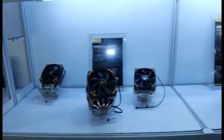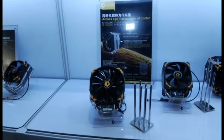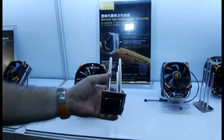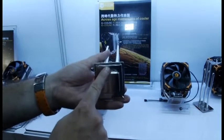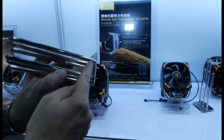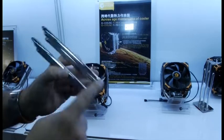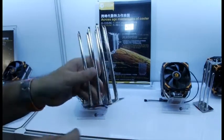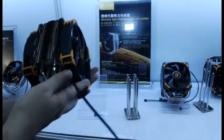Over here is what we really want to look at today — a cross-age masterpiece of coolers. What they've got here is a nice plate for the cooling in the base, which has the vapor chamber. Here we have the heat pipes — now instead of being sintered and sealed separately so that they only meet at the base, these are actually connected, so all of the cooling effect from the vapor chamber underneath goes all the way up the heat pipes directly.